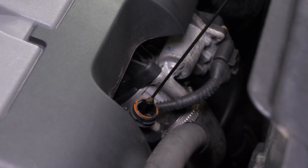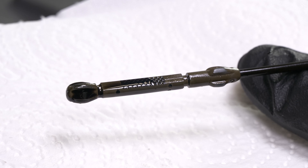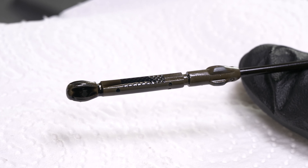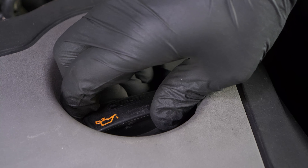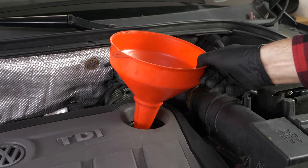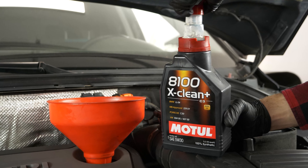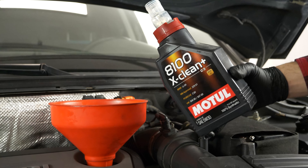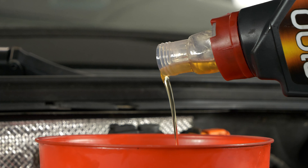The end of the gauge is stripped. Look at the edge of the gauge — it is this part which shows the oil level in the engine. This is considered to be perfect when it is in the middle of this part. However, be careful never to go over the maximum level — you risk breaking the engine. If you notice that the level is low, open the filling cap and add a little oil. We're just talking about a few centiliters, no more. After wiping down the gauge, put it back into the sheath to check the level again. Repeat the filling process until you reach the perfect level.